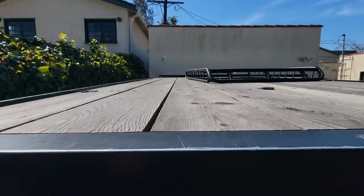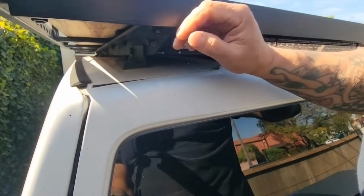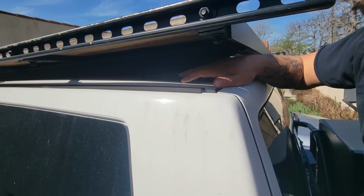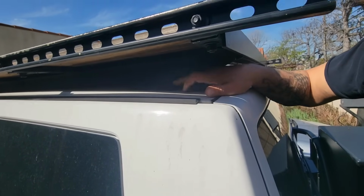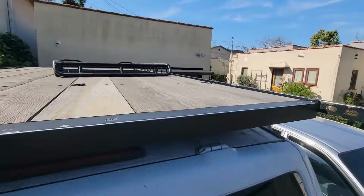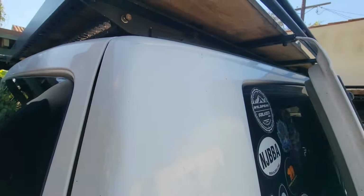We'll take a look at that in a second. But just so you see here, I made these, now there's multiple videos on this, but I made 6-inch long, they're 1/4 inch thick by 2-inch angle aluminum, and I mounted them right where the original factory ones were mounted. These brackets here. The sun's kind of hot over there, maybe you can see it better over here.